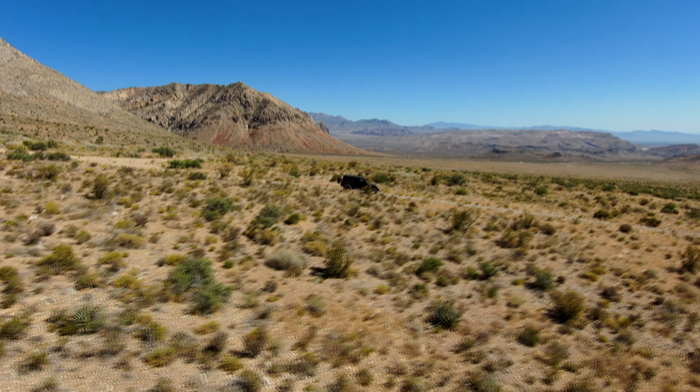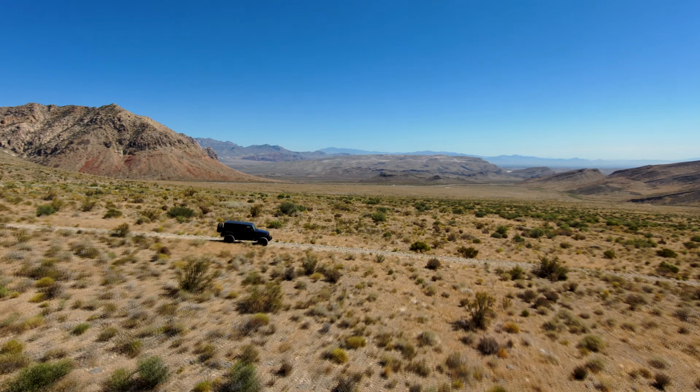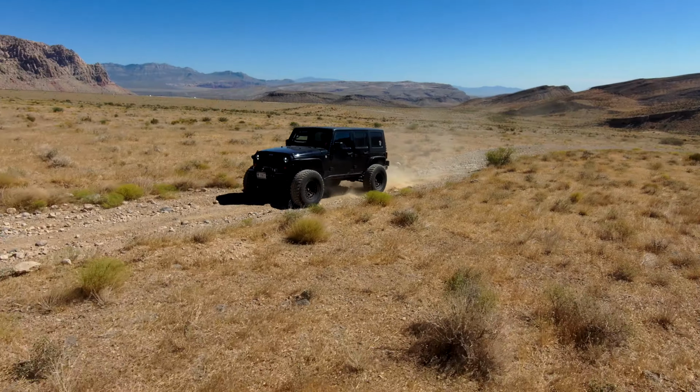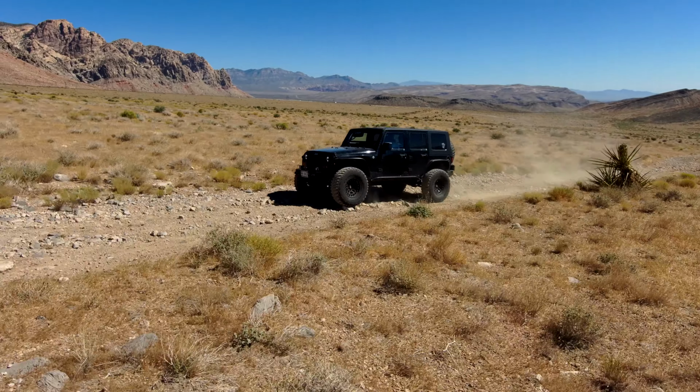It's strong enough, and those extra couple of gears do help just a little bit, especially with the smaller displacement engine. The 8-speed still does have a place, and that is in the really high-performance engines like a supercharged engine or a guy that's going to go out and beat on his JK with 42-inch tires.